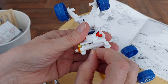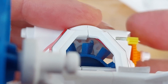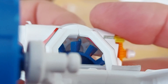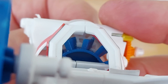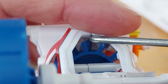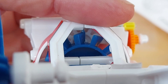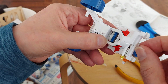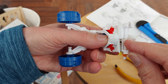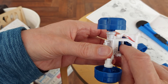We just take the wheels off. Yeah, that's stiff — there's something stopping that turning. I think I can see the problem. See that bit of plastic sticking up there? That shouldn't be there. And as we turn the motor or turn the wheel, that's jamming. On top of there, that little bit of blue sticking up shouldn't be there. Might be able to get in there with a knife and trim it off. I think we freed it up. Bit of lubricant. I also pushed that gear onto its shaft a little bit further because the gear that it drives was jamming on the back of the blue fan.